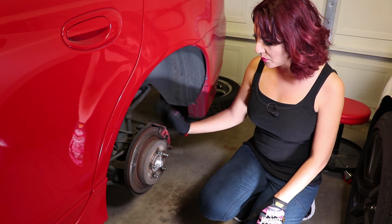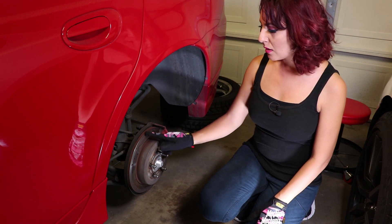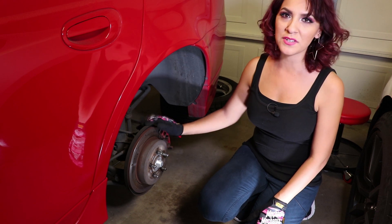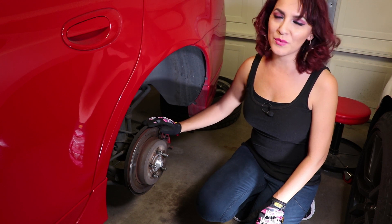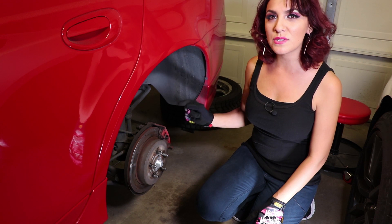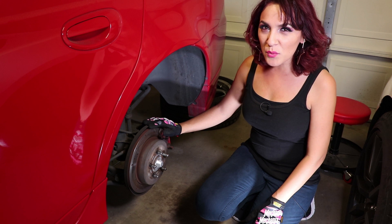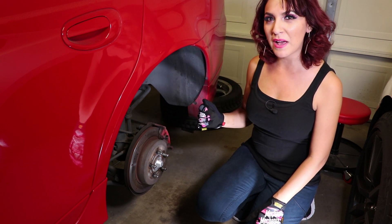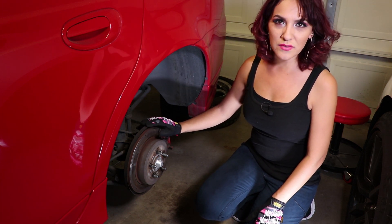As you can see here, the brake pads have all but gone and disappeared. The rotors have been really scratched up — it's really bad. Normally you can resurface the rotors at a shop, so all you have to do is buy new brake pads. But in this instance, we were going to get new rotors anyway, so we just let these get trashed. But normally if you hear noise and it's probably your brakes, better check them out because you're going to save yourself a lot of money.